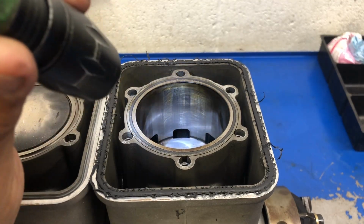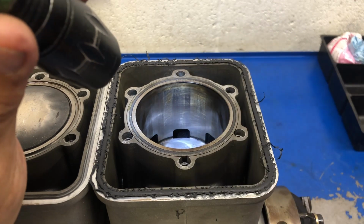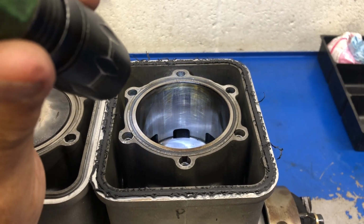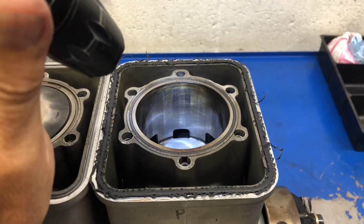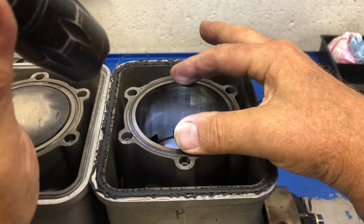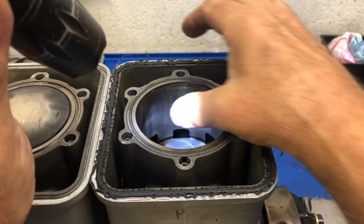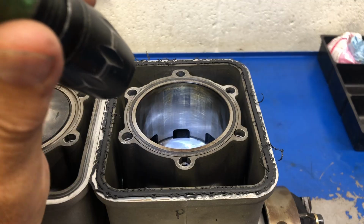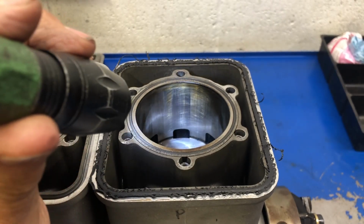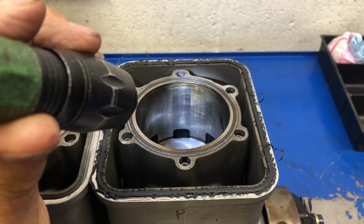when the engine has cooled a little bit, and then if you're one of those guys that just hammers the throttle wide open on overshoot, then the piston is going to get much bigger in diameter much faster than the cylinder is going to match that increase in diameter, and you can lose the clearance. And that's what this did. This is from pretty much zero clearance in between the piston and the cylinder wall at a particular temperature.